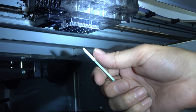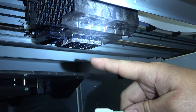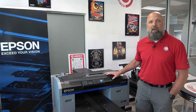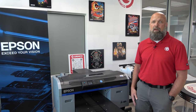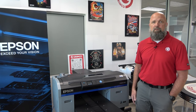The whole reason we clean that capping station is so we get a good sealant around these print heads when they're not actually printing. Everything is looking really good. That's all the maintenance I have for the machine today. Epson has made it really easy on us — this machine with the cleaning cartridge and the internal wiper unit is basically self-maintaining, just a little user intervention once a week to keep the machine running smooth.